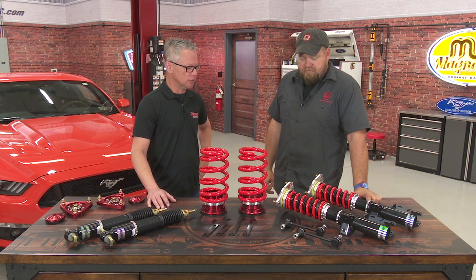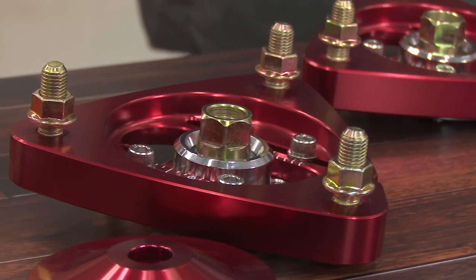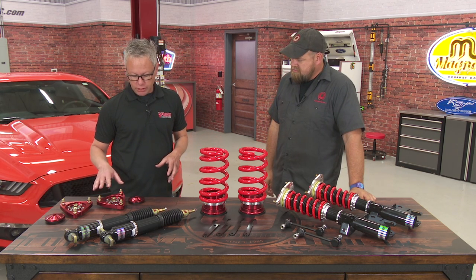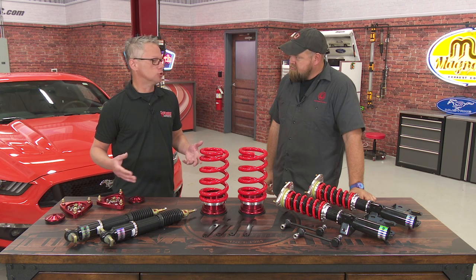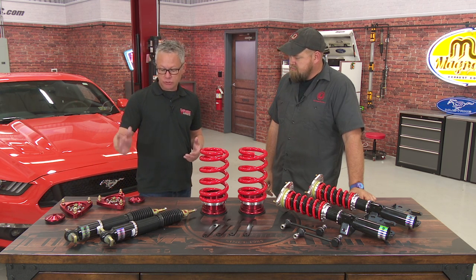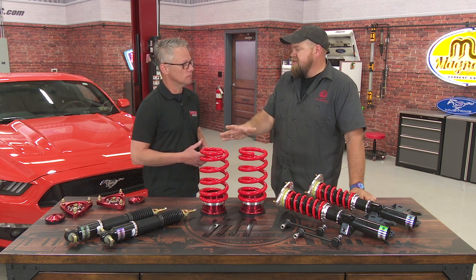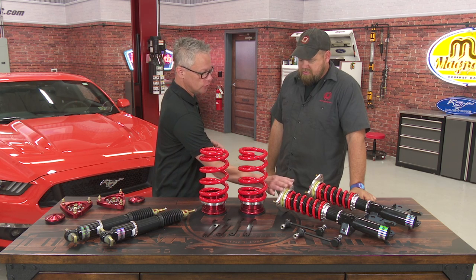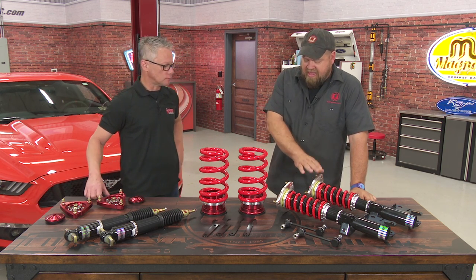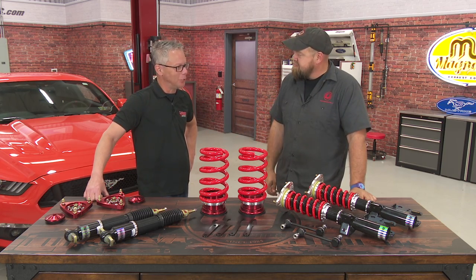It should be really nice out of the box. Now, tell me about the caster camber plates — you said they're not included with the kit, but they're something you might recommend. Exactly. They are an option and you can add them at any point in the future. But if you wanted to get more serious, perhaps tracking the car, and you wanted to dial in the front camber and caster, this would be the way to go. You'd simply remove the aluminum top mounts and replace them with the caster camber adjustment plates.